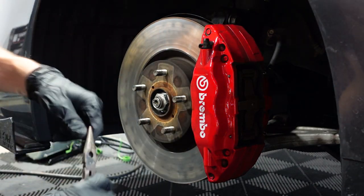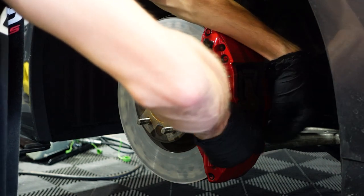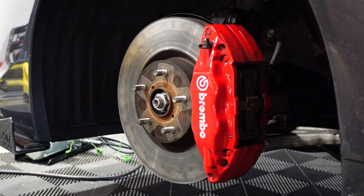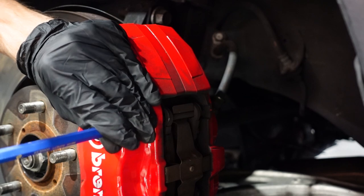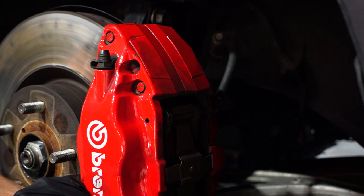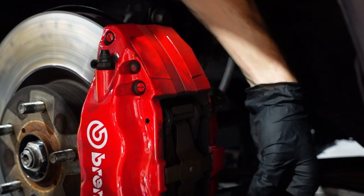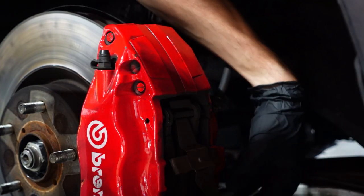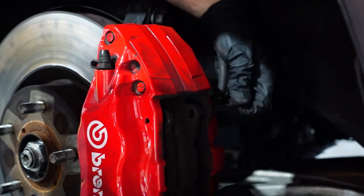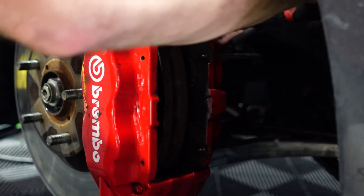There are two pins on the back here. We're going to pull these two safety clips out that hold in your pins. So now we can punch out these pins — this is a three-millimeter punch. We'll tap that pin through there, then come to the bottom pin and tap that through. Then on the backside where those pins came out, we can grab them and pull them out. That's going to pop this spring clip out, so just be wary of that. You can leave these pins in place on the caliper if you want to. Then loosen up the bolts on the caliper.